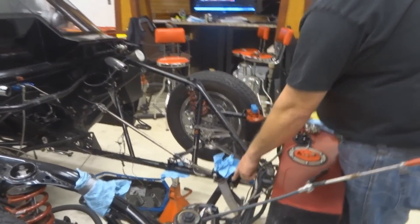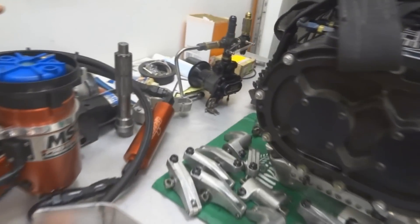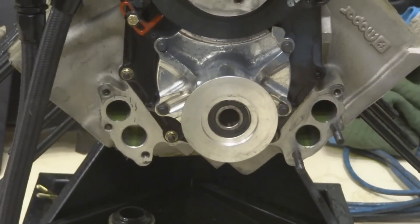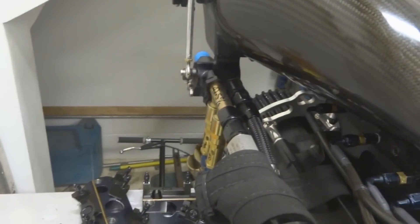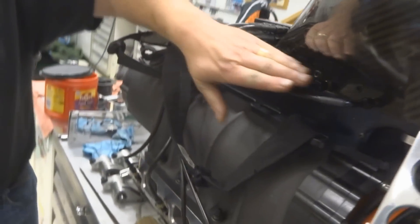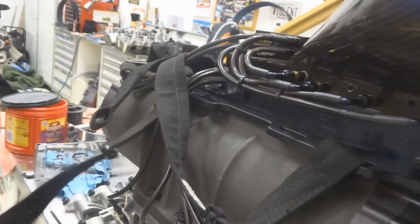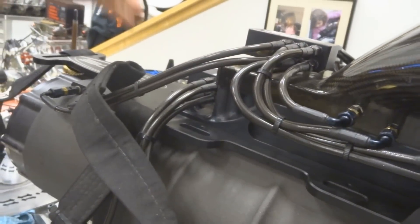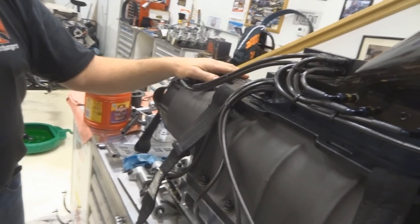There's a very large fuel line that runs up to a Rage fuel pump — that's what the fuel system runs off. It's a mechanical fuel pump that runs off the camshaft at the front of the motor. That pumps fuel up to the barrel valve on the front of the supercharger, which then pumps it back to a distribution block. The distribution block sends fuel to the carbon fiber injector hat fittings and also to the back of the supercharger to lubricate and cool it, which helps the Teflon strip seal better and makes more power.